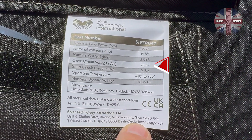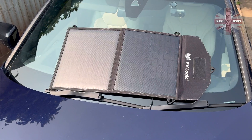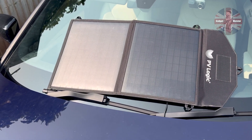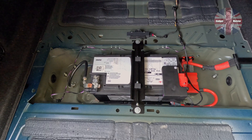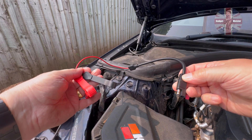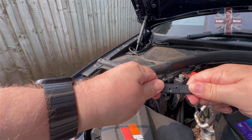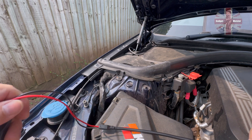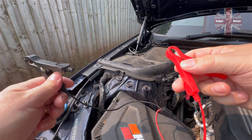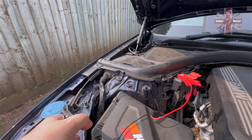You can see from the voltage here of 23.3 volts why you need the charge controller — you can't connect to the battery directly. As an example, I have the 40 watt panel laid here on the windscreen, just resting on the wiper blades and the cable running out under the bonnet. As BMWs have their battery in the boot, I'm going to use the charging point under the bonnet. So I'm going to select the crocodile clip connector and plug that into the charge controller, align the connectors and push them together, and then we can make connections directly to the charging terminals.